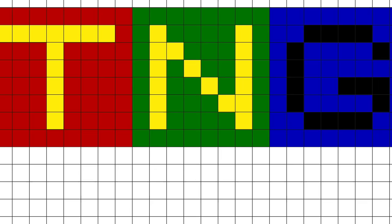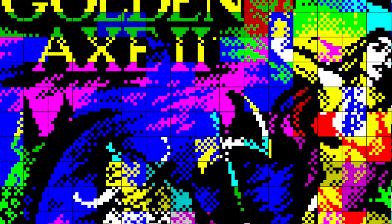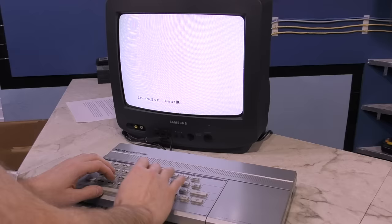When text is to be written to the screen, the CPU has to actually copy 8 bytes for every character, drawing them out one line at a time. For every 8x8 pixel cell there is a color attribute where you can assign colors to the foreground and background. Timex calls this the ink color and the paper color — you get 2 colors per cell. So there is a grid of 32x24 color cells. As you can see from a Sinclair Spectrum game example, you'll never find more than 2 colors per cell. While Commodore used a similar system, it had a 2-color and a 4-color mode which made it considerably more versatile.